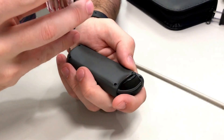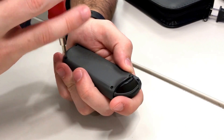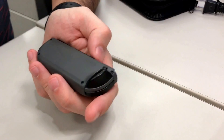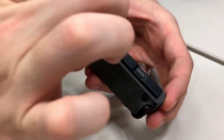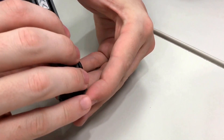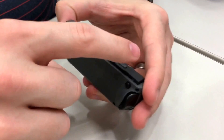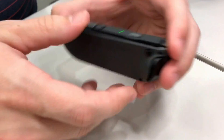There are four exterior screws to be removed. When you open it up, this black part is part of the back, so you can grip it to pry it open and the whole thing just kind of comes apart. There are two ribbon cables on this side, so don't hulk it.